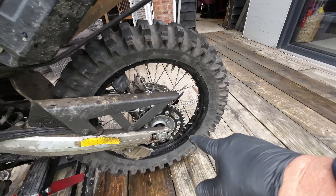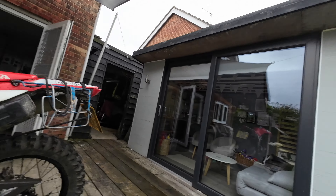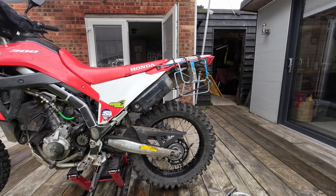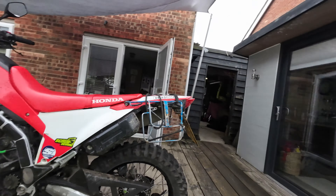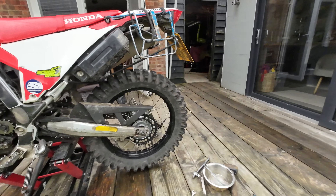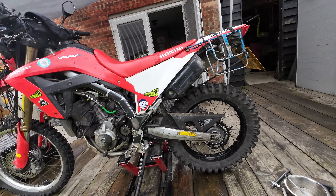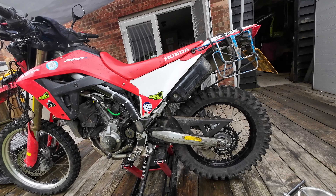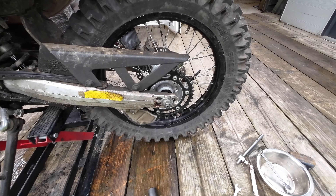New wheel bearings in the rear, and the seals had a bit of a hold up there. I put the bike on the deck a couple of days ago and the missus wasn't happy. I went to get some wheel bearings - some FAG ones from Bury St Edmunds - and they didn't have the seals. You can't put them back on with worn seals, so it's been sitting there a couple of days. Put them in the freezer and they drop right in.